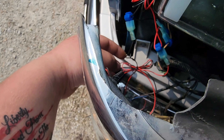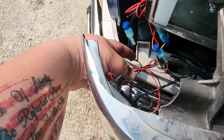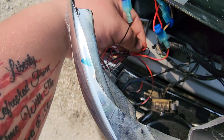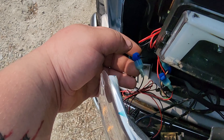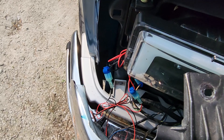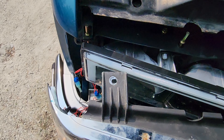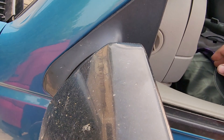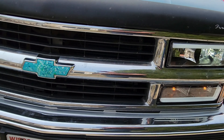You can see the black and red wires down there — we had to splice into each. We spliced into the low beam and grounded it with the red and black. Then for the top bars to work, we went into the same wires, connected the red and black all together. We had to buy some clips — just a little splice kit that you can get, they're like five bucks at O'Reilly's. That is the whole project.